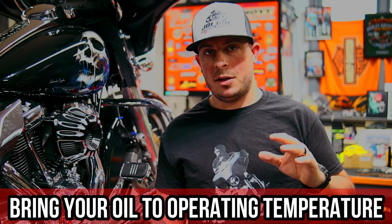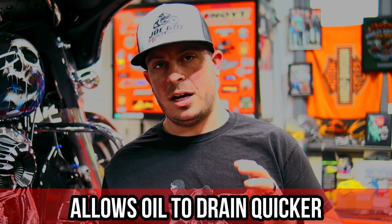Before you start your oil change, you want to go out on a ride for about 15 minutes so that way your oil can get up to proper temperature. This is going to make the oil thinner and it's going to drain out a lot quicker.